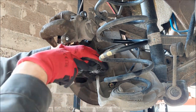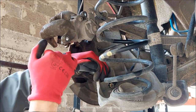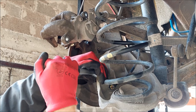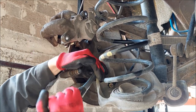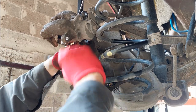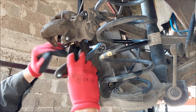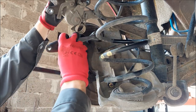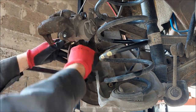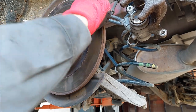Next I'm going to remove the two brake carrier bolts — they are 8 millimeter Allen. I can already tell that these are too tight; they shouldn't be going this hard. My guess is that somebody either over-tightened them or used permanent thread glue.